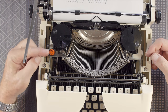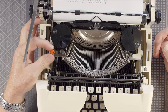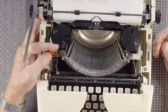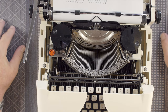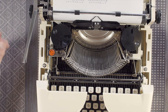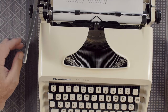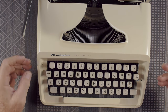Inside the ribbon cover is an orange knob — the touch adjustment. You screw it in and it pushes down a lever, extending a spring inside the machine to tighten the tension. Released all the way, that's about as light as the tension gets. As it is, it feels somewhat like a Brother or a Silver Seiko Japanese portable — it has that heavier kind of touch. It's not quite as light as some of the more premium ultra-portable typewriters.